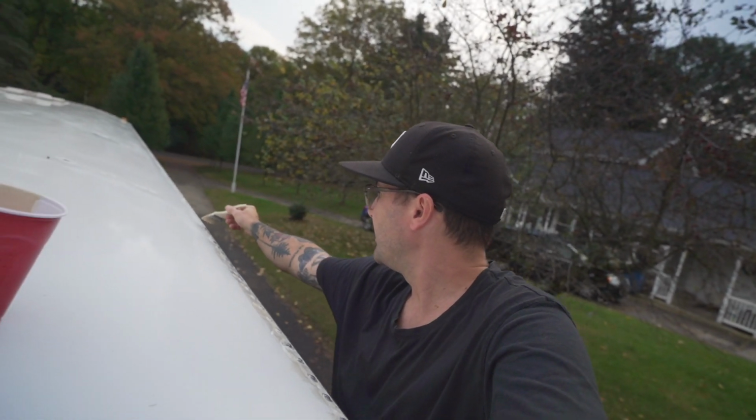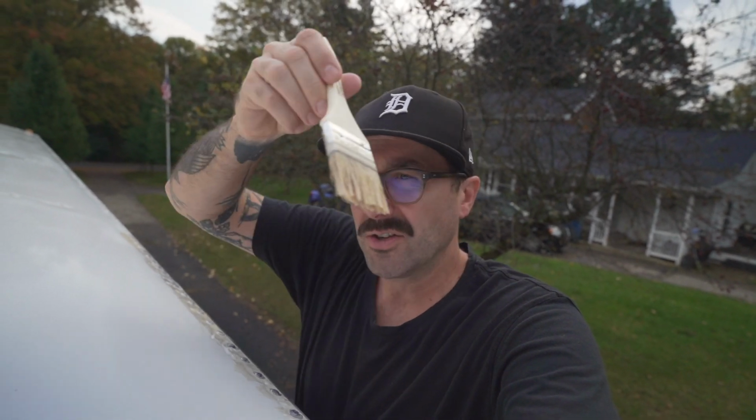If you are doing a bus conversion, you are going to run into rust for sure. There's a couple different products that are out there, all that kind of do the exact same thing. Now, the one caveat with Corroseal and most other rust preventers is you can't have layers of rust or like a flaking rust. You do need to grind it down so that you're as bare metal as possible. And then this is actually just converting that top coat of rust. This is not something that would take, you know, a rusted through panel and completely convert it. You'd need to cut out areas that are sort of flaking in rust. Get that ground down to bare metal, and then you'd be good to go.